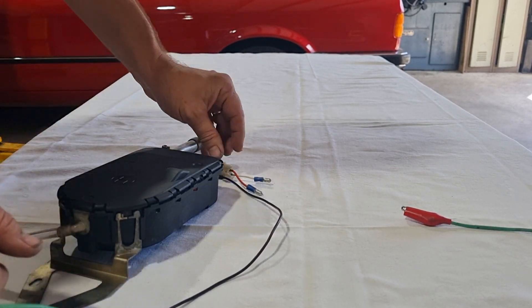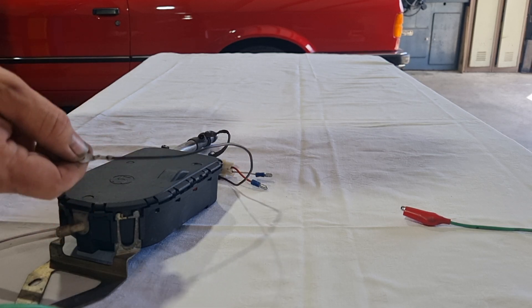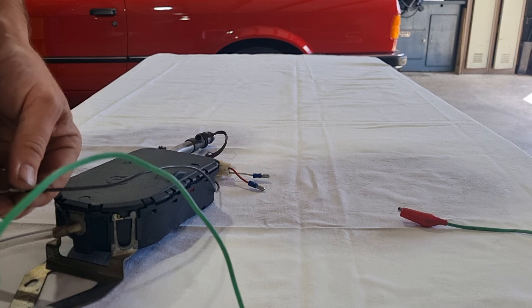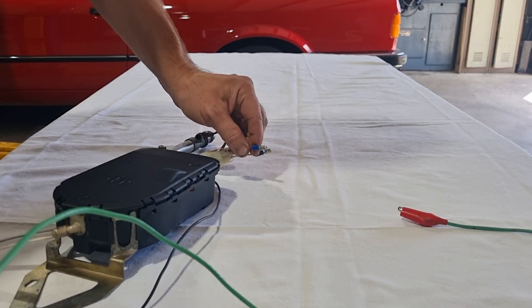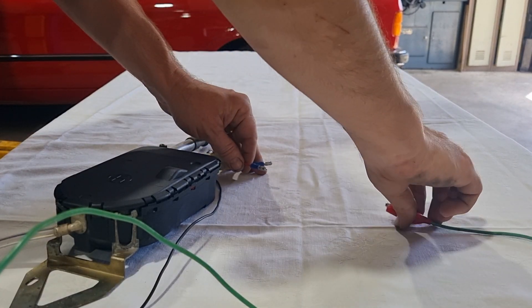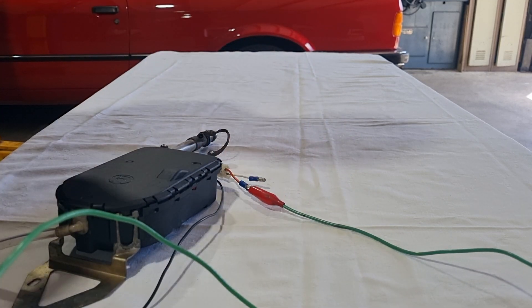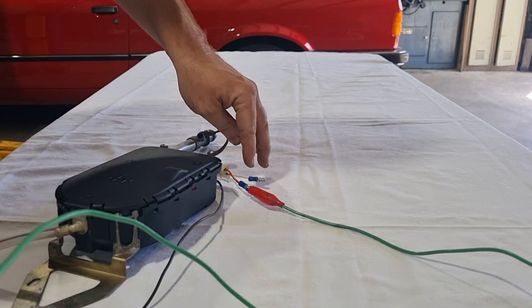You've got three main wires to pay attention to. The black wire is usually on the body of the vehicle — that's the ground or negative — so today we'll connect that to the negative on our power supply. The second wire is the red wire, which is 12 volts positive constant, so we'll bring our power supply wire at 12 volts positive across onto that wire.